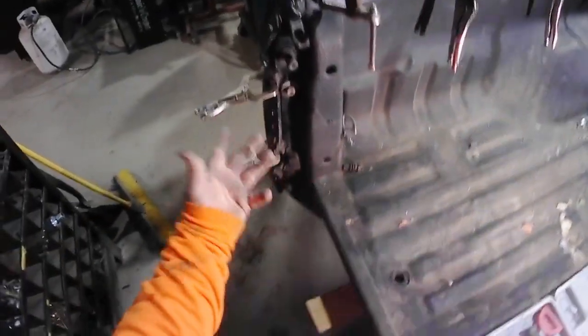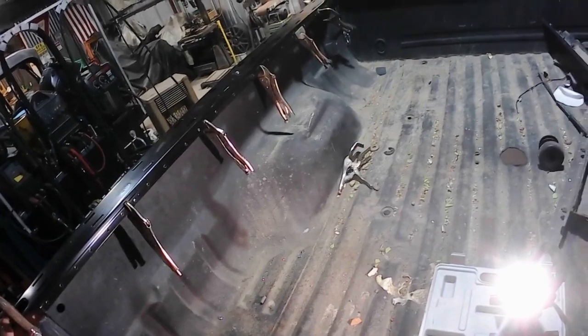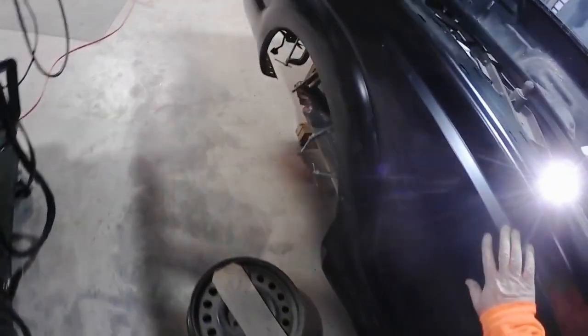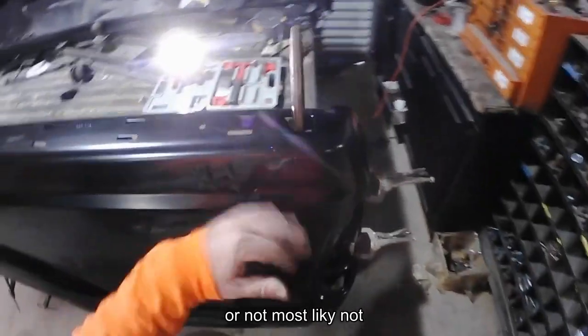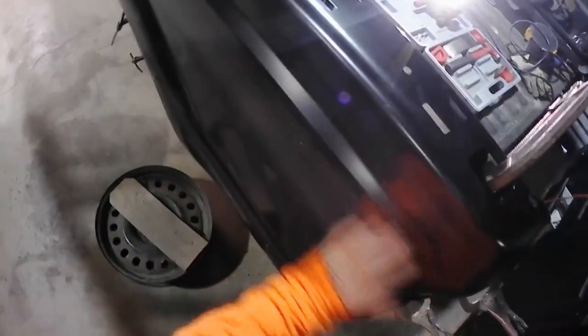This side had to be drilled, and then I got to start plug welding it. Get done plug welding it, and then we'll put a little body fill over it and make it all look smooth and pretty. And then a little layer of primer over this outside skin, because we'll get some marks in it from where we welded. Clean all that up, but there shouldn't be anything out here, we'll see. And then, hopefully, like I said, we'll be painting on her by week's end. Get this thing done. Get the first layer of black on it.